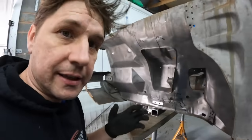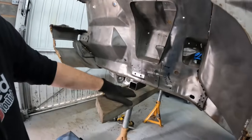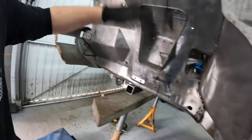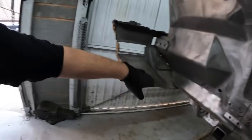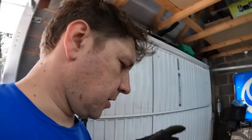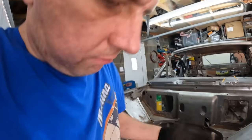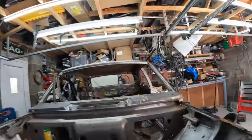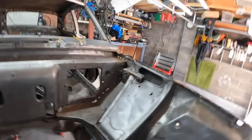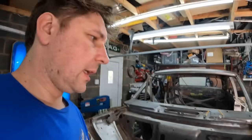It's lived there for 50 years - it wants to stay there. I've got a brace with a jack, sand block, and block of wood on both sides with a bit of box tubing to support the weight when it drops. It's disconnected from the front, so hopefully it should slide out. That's one side done. I slightly gouged a few little bits with the spot weld chisel but it's fine - we weren't really going to use that cross member panel anyway, and it can be repaired. It's pretty much loose now. We just need to get one last bit of metal that's attached down here, and that's the passenger side done.